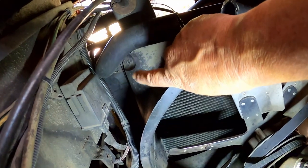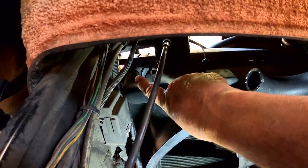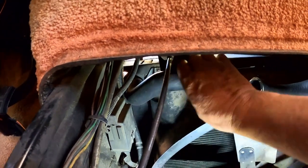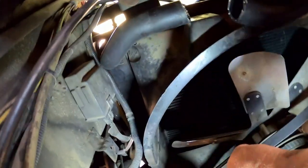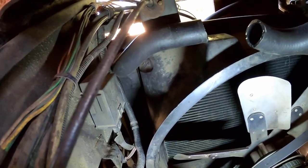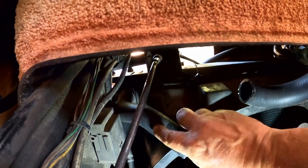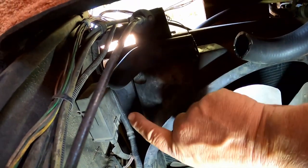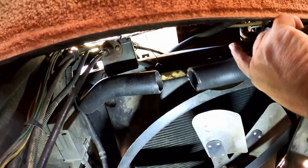that was really, really hard to get access to that clamp up there. It was really hard to get the old clamp off when I did the water pump and put new hoses on it, because the clamp itself was messed up and access was terrible. Had to get a super long extension up from all the way at the bottom. It was just crimped at a weird angle, in a weird little spot. So I tried to put that new clamp in a more easy to access angle if you ever need to get to it. But even at that, it's still really kind of difficult. So I don't ever want to do that again if I don't have to. Anyway, we got it done without doing that.